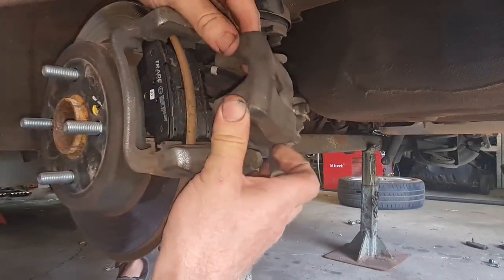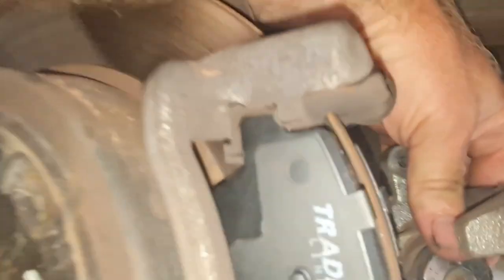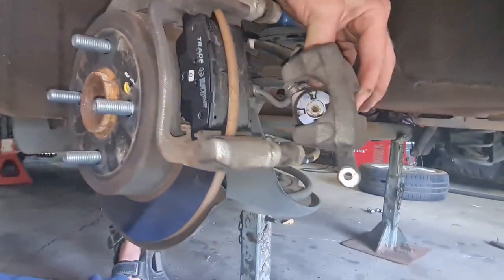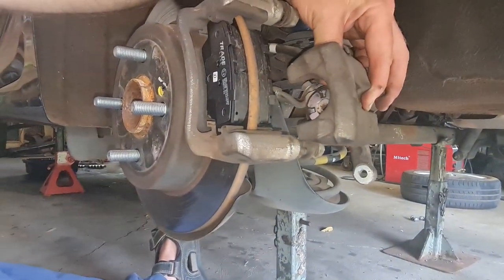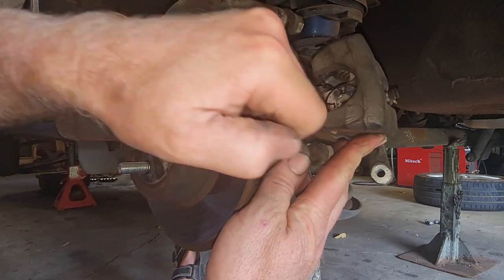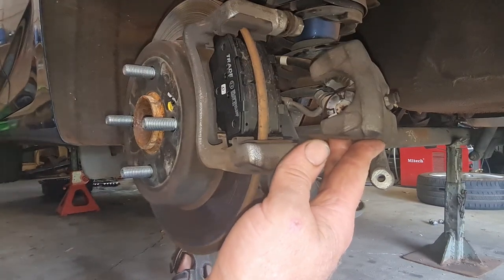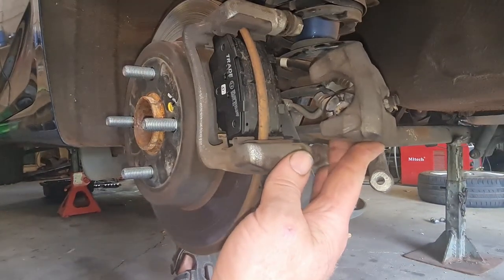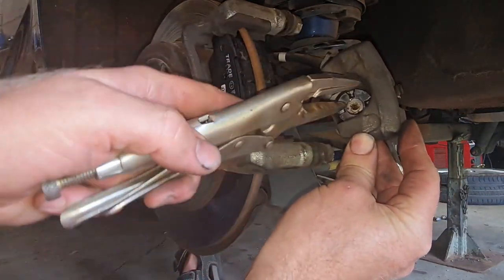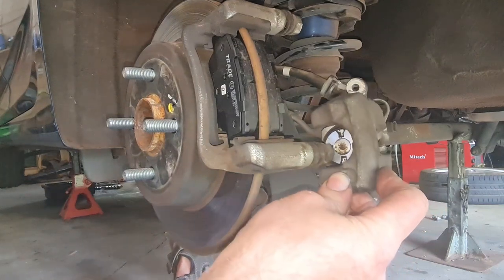These rear calipers — in order to get the piston back in, you've got those little indents. This piston needs to be rotated around to drive it back in. There are some kits of tools you can get to do this. Some of them are pretty fancy — you've got a big threaded bar and everything, you screw them from the outside. They're kind of expensive; the cheapest one I've seen at Repco was $150. You could use a pair of long nose pliers or something to get in there and try to rotate them around — but that's a pain.